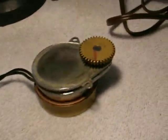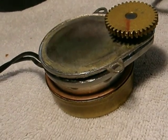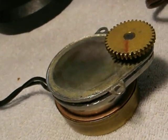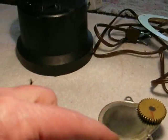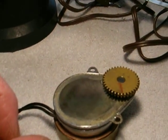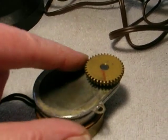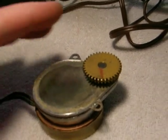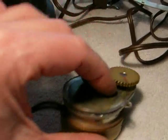There are two methods. There's a wonderful website — if you look up Jefferson clock repair you'll find a guy who's devoted an entire page to these clocks. His method is to heat this area — it's soldered here — but if you do that you're probably going to burn the phenolic gear inside, because you have to heat the whole thing evenly to soften the solder. I chose the Dremel with a cutoff wheel.